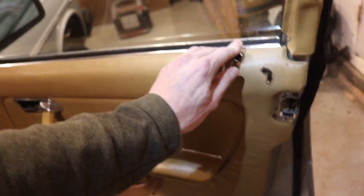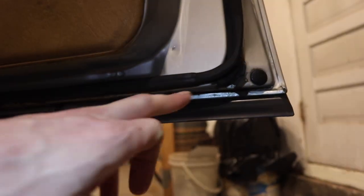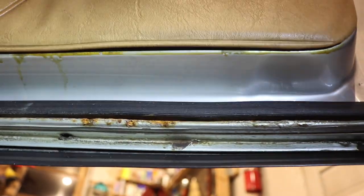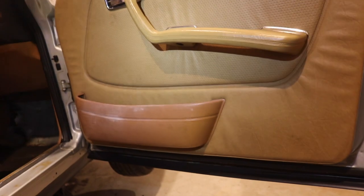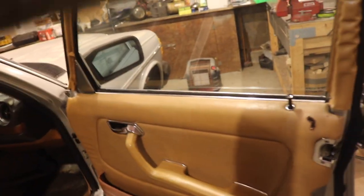Here in the garage I took all of the door panels off one by one — none broken — and lubricated what I could as far as locks and things of that nature. I also checked to make sure the door drains, which are in this area — hard to see, you gotta get on your back — are clear. There's a little rust right there, but that's about the most rust on all the doors. I cleared all the drains and sprayed fluid film with a straw all in the bottom and sides, mainly on the bottom where water runs down and drains out. Did it on all four doors.